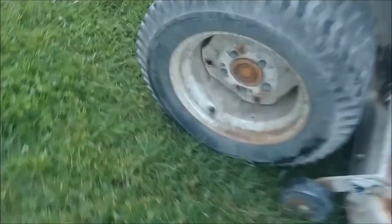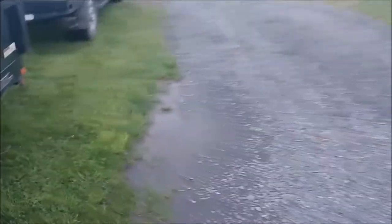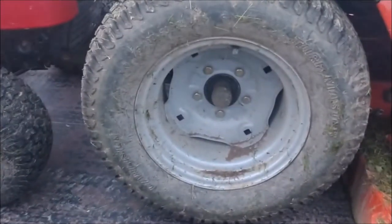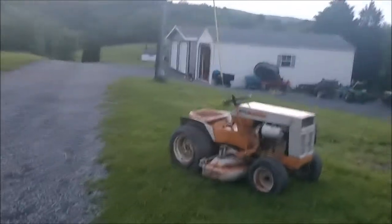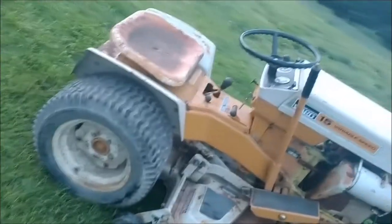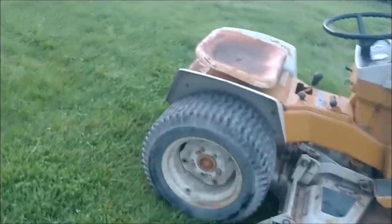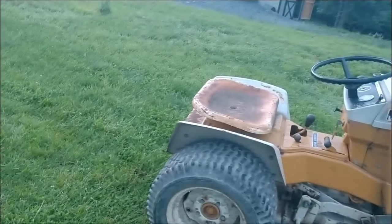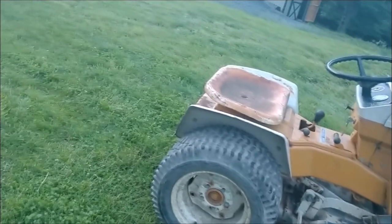The rims on the back here - if you look, it's completely different compared to others. They have been completely flipped around backwards and drilled a hole and put an air stem in it backwards. That's how they installed the rims. The rim is reversed like it's supposed to be and they drilled a hole and put an air stem there. So that center plate of the rim is not completely centered. I'm thinking they flipped it around so they put the tires closer to the frame. But I'm definitely rotating it because it gives me like almost four inches of clearance on each side, so almost eight inches total. So if I'm going to be putting bigger, wider tires, I'm definitely going to need that space between the tire and the frame.